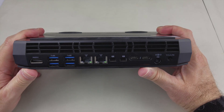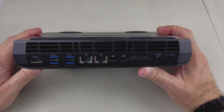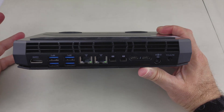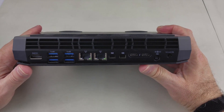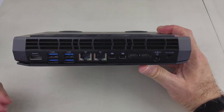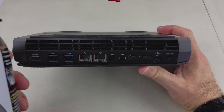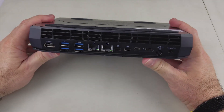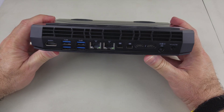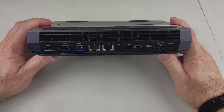As long as you periodically clean it, that's sufficient. If you disassemble the unit and clean it thoroughly, you may get away with cleaning every four to six months. If you use this blower method without disassembling, then every three to five months — maybe a month's difference. In a dusty environment it collects quickly; in a clean environment slowly. Using a compressed can of air is sufficient for more than 95 percent of cleaning.